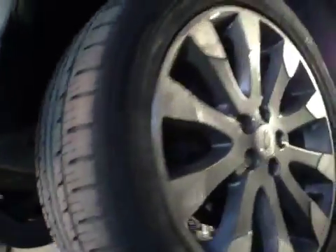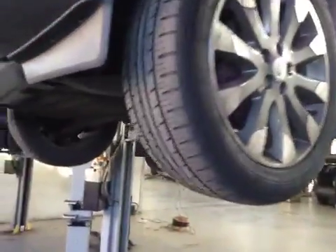Hi, I'm Dan. I'm going to do a car check today. The front tyres are in the amber section of the health check — no cuts or bulges to the sidewall, and they are below 5mm.